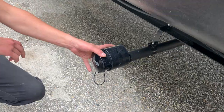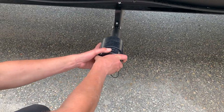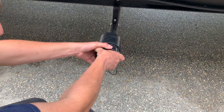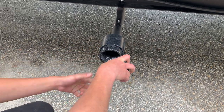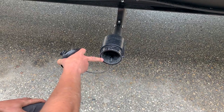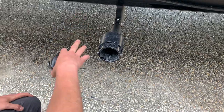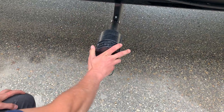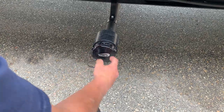You're going to notice this one lone drain over here, taking this cap and twisting it off. You are pre-plumbed and wired for washer-dryer combo. If you're wanting to get set up with that, you can contact the parts department. Whenever you're using that washer-dryer, you have to make sure that this cap is open. That way it allows the washer to drain its fluid. If you're leaving this cap on, it will backflow into the unit, so just being mindful of that.